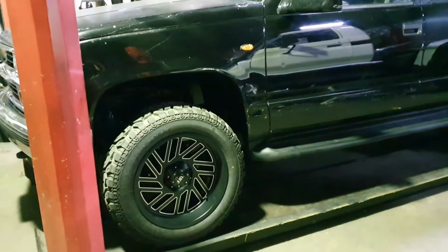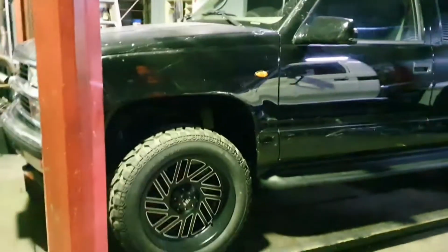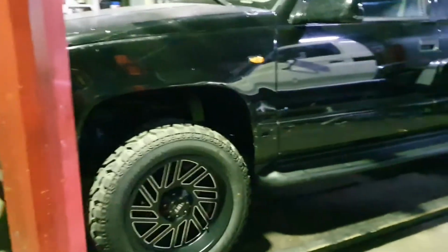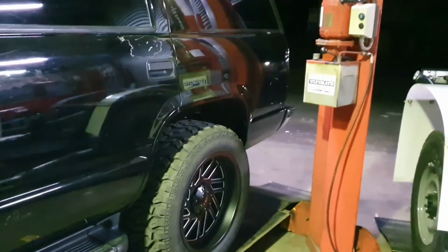This is our side profile at the moment. That's the front, torsion bars wound up. Like I say, 2 inches. Pretty cool. But the rear is quite down now in comparison. Torsion bars went really easily. This car has never really been off-road, so underneath it's really quite nice. Wound up really well. The plan tonight is to get the rear to come back up.